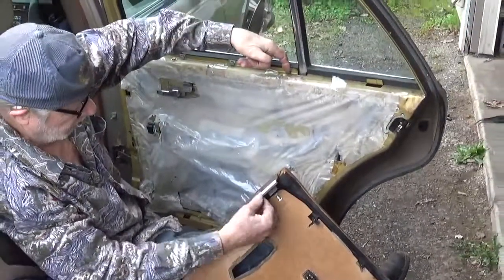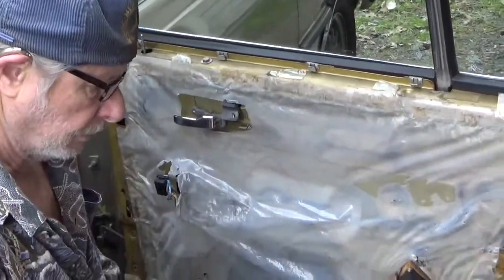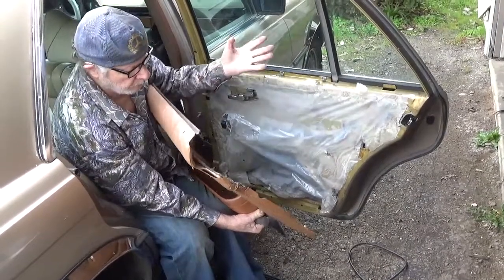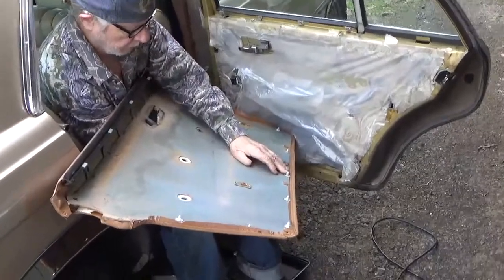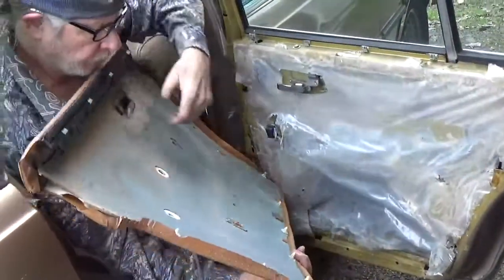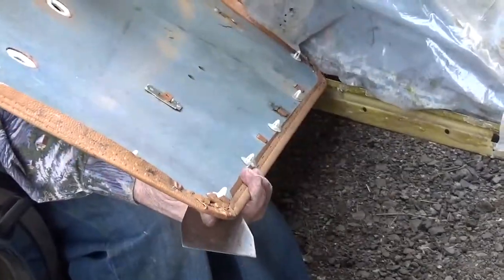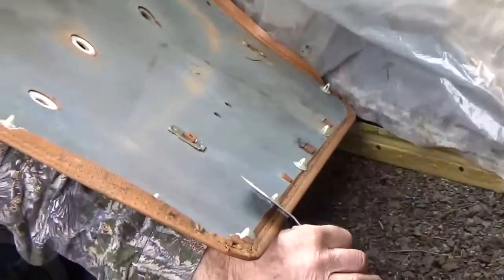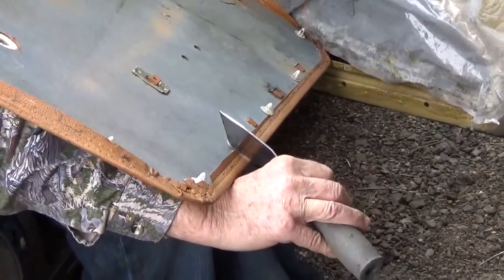Also the top edge here goes into these clips, which is another reason why you have to lift the panel up to remove it. However, the 123 body up until '85 has a different type of fasteners — you pull the door panel straight off. When you do that, you don't want to just yank the panel, because the cardboard can be deteriorated and the clip will pull out and damage it. So what you do is run a knife between the door and the door panel right up to that clip and then twist it. That way you're putting pressure on the clip, keeping it in the panel.